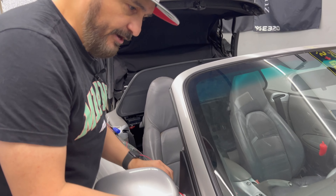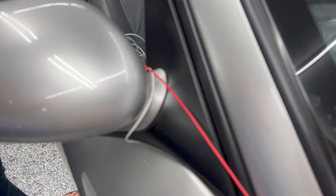This wire bypass ended up being the solution. It was an actual short to ground in the wire going from the ECU to the sensor — not the sensors, not the valves, not anything else. The advice? Don't be like me throwing a thousand-plus dollars at parts. This car came from Florida and was really abused, so I kept assuming it was a part — but it was a wire. Start at the foundation and work your way up until you identify exactly what's wrong. Thanks for watching Yogi's Garage — we'll see you next time.